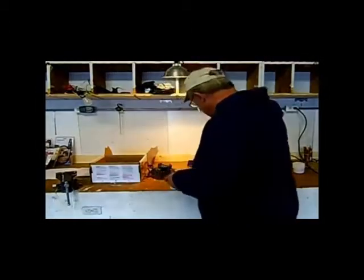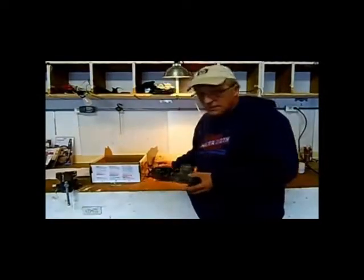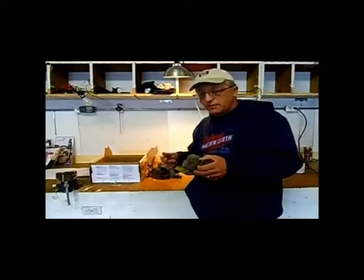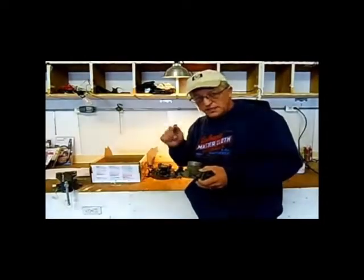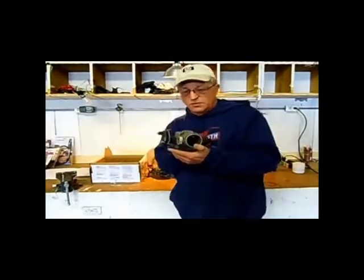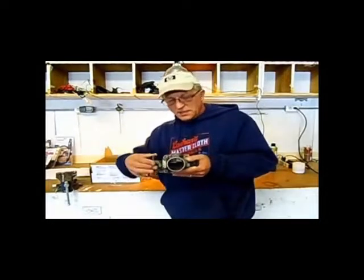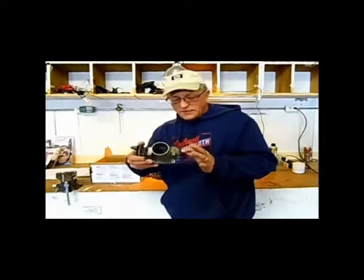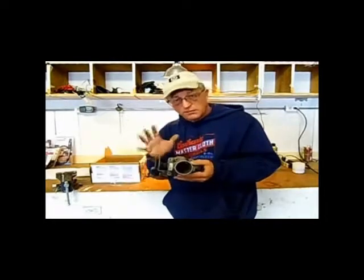From the throttle body units, advancements were made. The computer gained more and more control over the system, so they didn't need to have all the injectors up here. They moved to a multi-port system where the injectors are actually mounted just before the intake valve. Then the throttle body became a whole lot simpler. All you have is a cable that opens and closes the throttle plate, and a connector for the throttle position sensor.